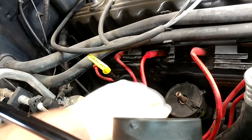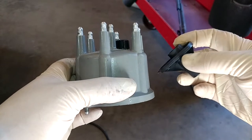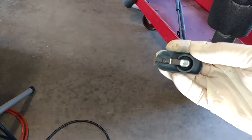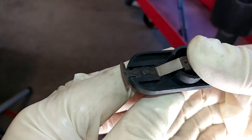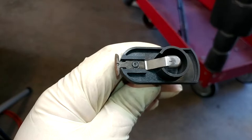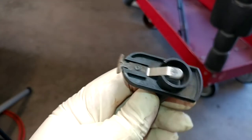There's really no magic inside a modern EFI distributor — there's just a magnetic pickup in here and that's it, the computer does everything else. These old cap and rotor were not high quality parts when I bought them. I was actually chasing after another problem I thought was an ignition problem — it actually ended up being a forward O2 sensor. So I'm sure these were the cheapest parts they had at AutoZone. This rotor is made in two pieces just like the new one, which is strange. But these are not brass — this cap appears to be aluminum and this rotor might be steel. You can see the rotor is actually rusty — that's why we want to buy brass ones when we can, because brass is a better conductor than steel and brass doesn't rust.